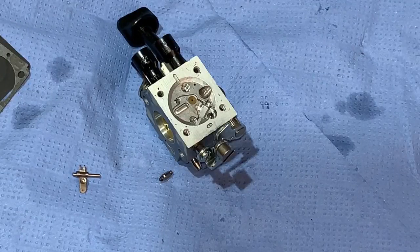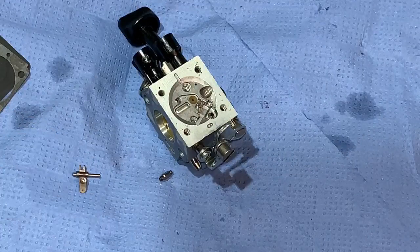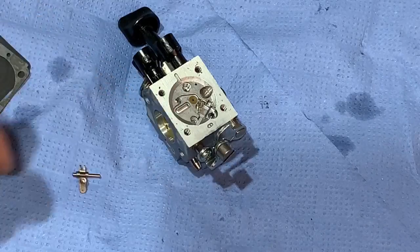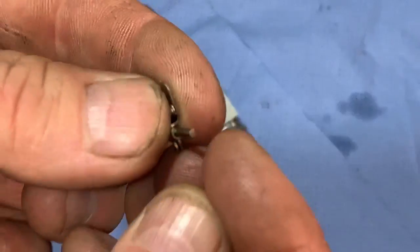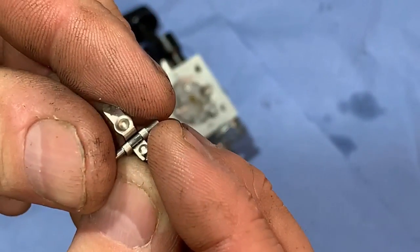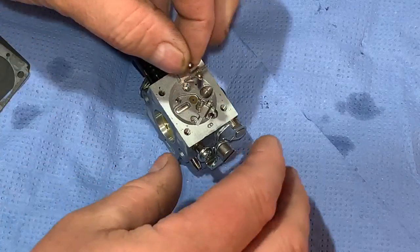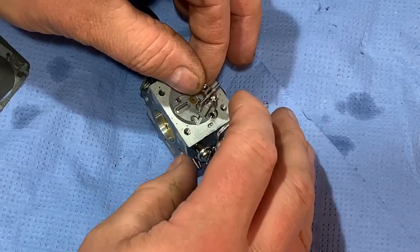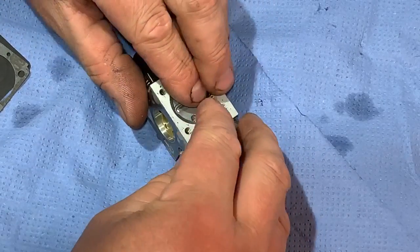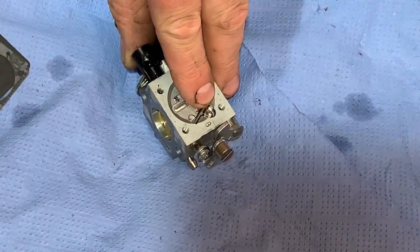And on the other side, I'm going to put the needle valve back in. I need to rest that spring in there first, and it has. It's better if I can get the carb more level, really, but this seems to be balancing in there okay. Now I'll put this like that. Then I have to put that in to where it's got to go in one sort of move, really. So then the spring will be in place. So let's go for it. And I've done that nearly. And we are in. Just got a little bolt to put back in there now.